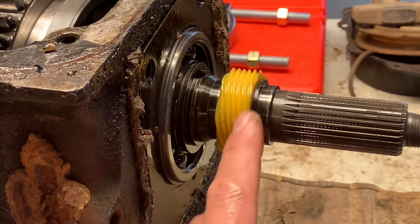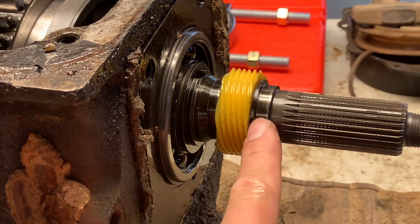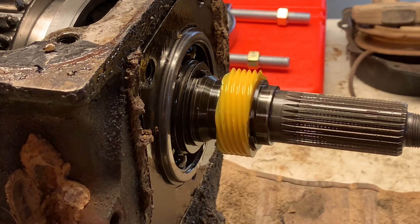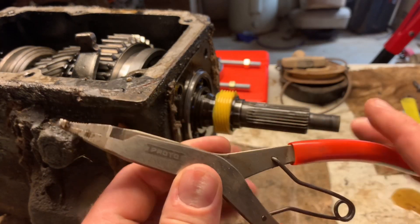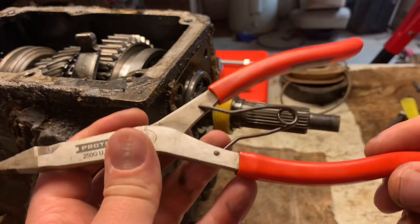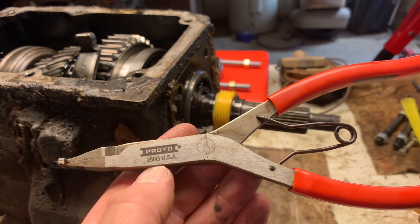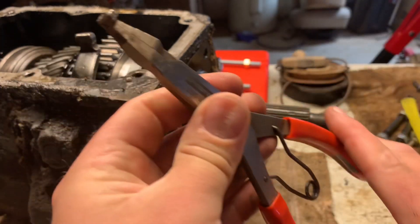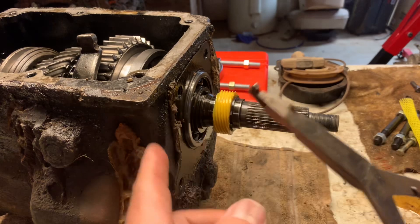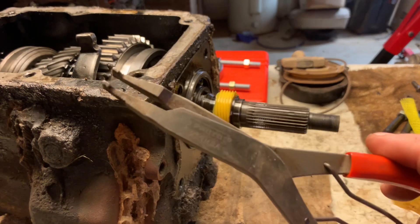So this is what drives your speedo cable. I'm kind of surprised it's plastic. There's a little snap ring right here holding it on, so we're going to go ahead and get that off. These right here are the best snap ring pliers — I've used them a bunch, taken a bunch of transmissions and transfer cases apart with them. Made in USA, they're Proto brand. I'll have them linked down in the description. Even just for a little T90 or something, you're going to want a pair of these.